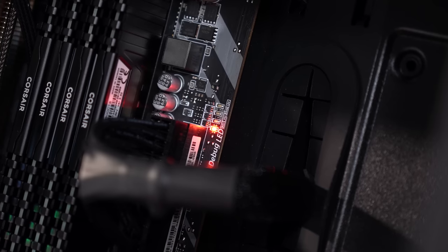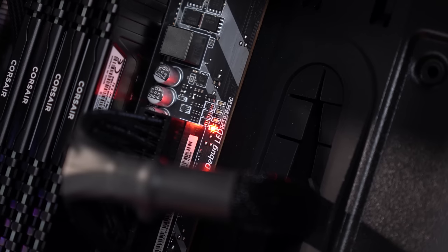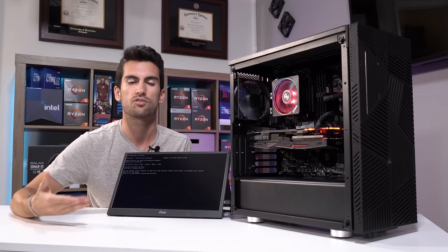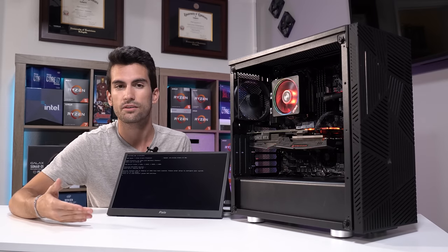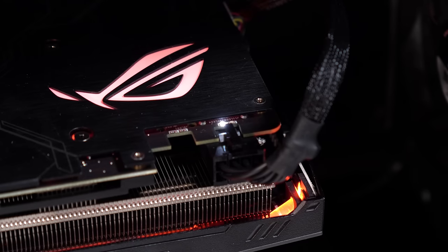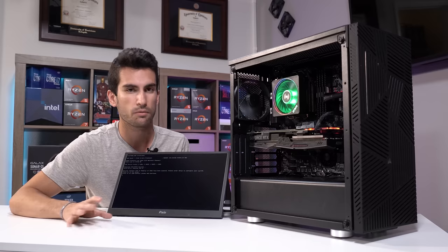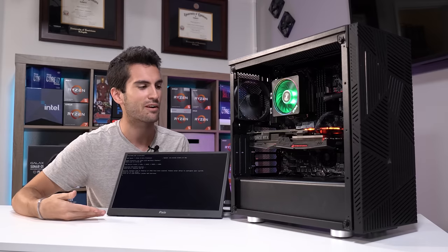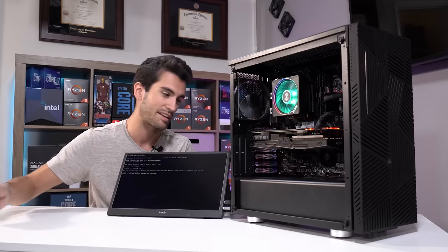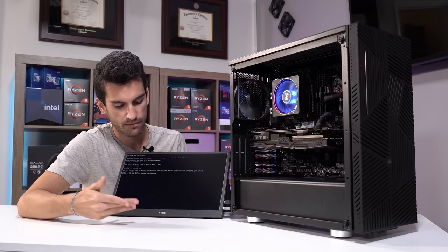There's actually a debug LED section at the top right of this board, and I noticed as we were power cycling, there was no LED lit up at all for anything — the CPU, the RAM, VGA, none of that was lit up. The system looked like it was booting, looked like it was trying to post, we just had no picture out. The LED on the graphics card, especially the one above the 8-pin supplemental PCI power connector, was lit up — that tells me the card's receiving power appropriately. The fans were spinning, everything told me that this build should be working. The only issue was we weren't getting a picture out. I was maybe concerned that it might have been like an HDMI port issue — that's very rare, but if you're connecting and disconnecting cables all the time, you could probably screw something up. But yeah, clear the CMOS, there you go.